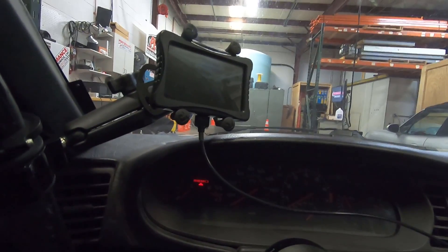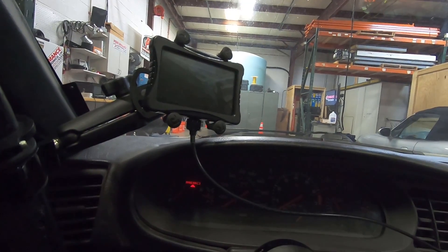The car is completely buttoned up. David from Performance Electronics just added one of their race dashes, so we're going to be able to monitor all the vitals better. He also helped me set up some alarms — so if for some reason the belt comes off and coolant temp starts going up, we'll have a big bright alarm on the race dash. One of the main reasons we want to have the car on track is to test our oil pan design and make sure we're not starving the engine of oil in higher-G corners, so we set up an alarm for oil pressure as well — if it drops below around 20 to 30 PSI, we'll get an alarm for that.